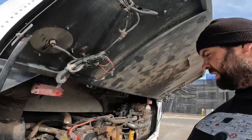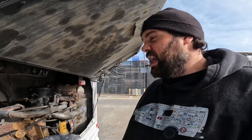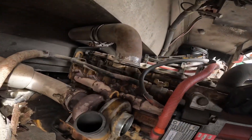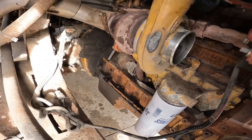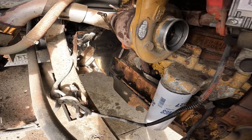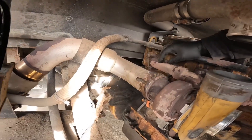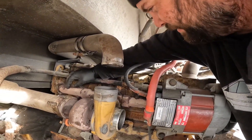My back's already hurting. I got all that off — broke some more bolts. Well, it's not really broken bolts, it's that the clamps are so rusted that the bolts on those are twisting out and breaking. I got the band on the turbo loose so it can be clocked. Wow, something was rubbing on that. Interesting — this bolt broke and it appears to be really stuck.